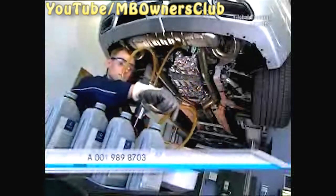Then fill the gear set with new fluid. Pump until fluid runs out of the filler hole. Let the surplus fluid flow out because overfilling can damage the transmission. Afterwards, close the filler hole again.